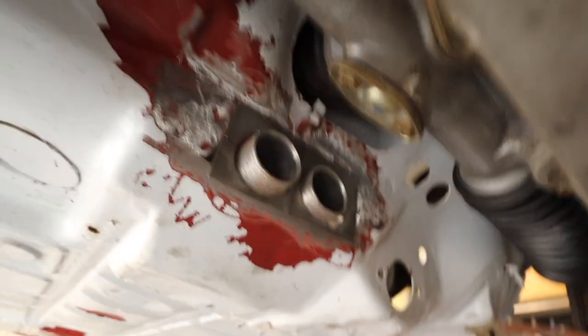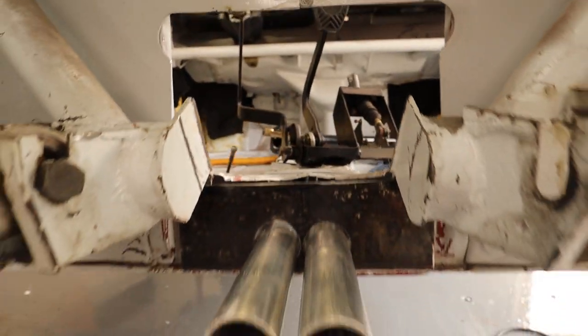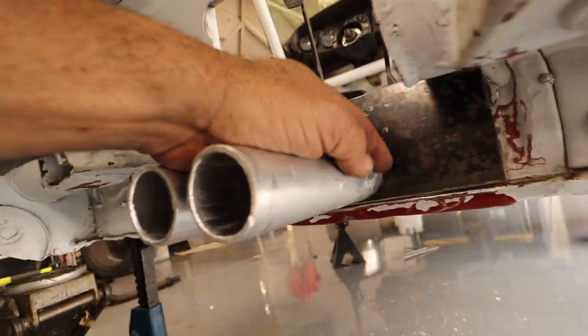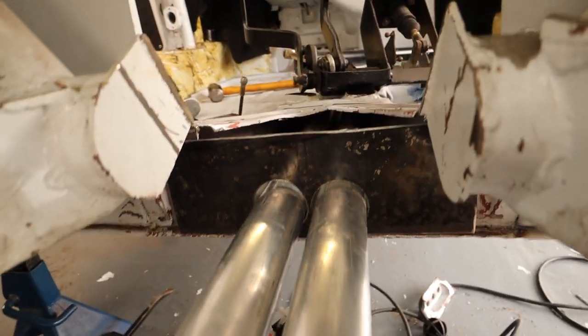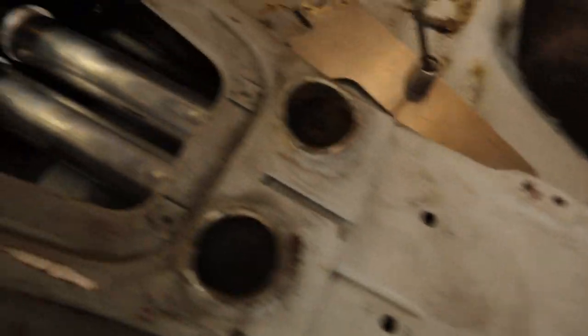I am filthy and my garage is totally trashed, but I have a really cool bracket up front. I have a really cool bracket in the rear. I'm not gonna weld them in just yet because I've gotta run brake lines, I've gotta run shifter cables, I've gotta run shifter hydraulic, I've gotta run a whole bunch of stuff. So I wanna keep that back plate intact. Then in the front, I'm gonna have some 90 degree bends welded on so I can fit, you know, regular radiator hoses and still avoid the front steering rack.